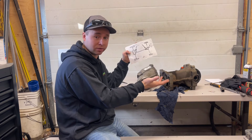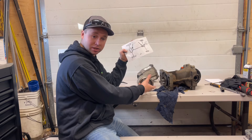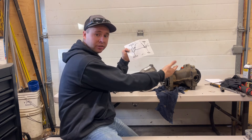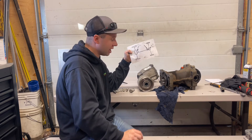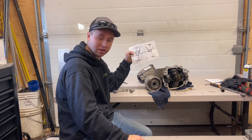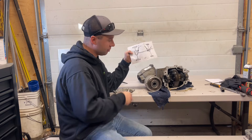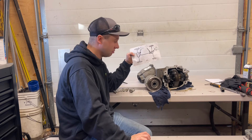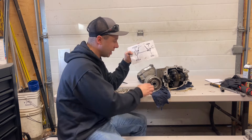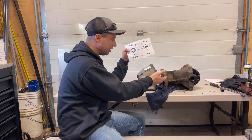That's a common failure. Or if you're getting codes, there can be clutch pack failures. In my case there were no codes at all — it was applying the system, but the back wheels weren't spinning. The electromagnet was activating the clutch pack and the shaft in there would start spinning, but since the splines were stripped, it was spinning on the splines and the diff wasn't doing anything. After that it goes into your rear diff, the RDU, which again is a non-serviceable item from Ford. It has a regular pinion gear, crown gear — everything like a regular truck differential — but using CV shafts now. These differentials can get ripped out. You can get a good diagnosis by pulling your diff plug. If it's full of metal, that tells you a lot. Commonly the failures on these are going to be the actual clutch pack, the PTU, and the actual diff itself.